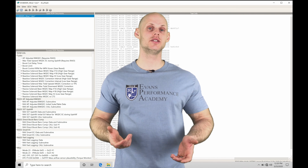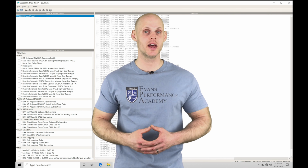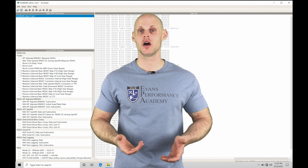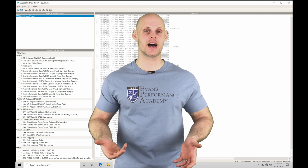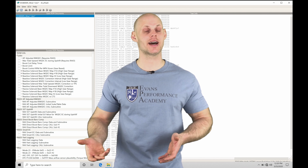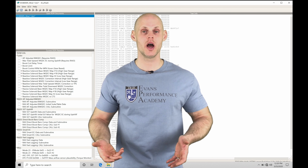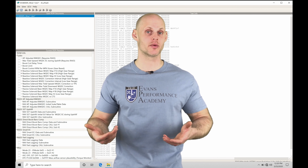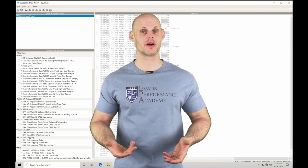Welcome to Evo 10 ECU Flash Training Part 14. In this video, we're going to take a look at working with our idle control. Now the Evo 10s are a little bit different than an Evo 7, 8, and 9 applications. The Evo 7, 8, and 9s had a stepper motor for idle control where we command the stepper motor to open and close a certain amount to get the desired airflow that we're after, to get the engine to fire up and run and idle properly.